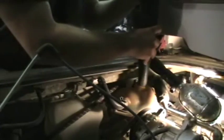Alright, next we're going to go after the cooling system, which of course has to be drained, and we don't want to make a huge mess. So I like to cheat a little bit. We clean out the wet dry vac so that we can take the fluid back out of it. We just vacuum every part of the system we can. Alright, go for it, man.